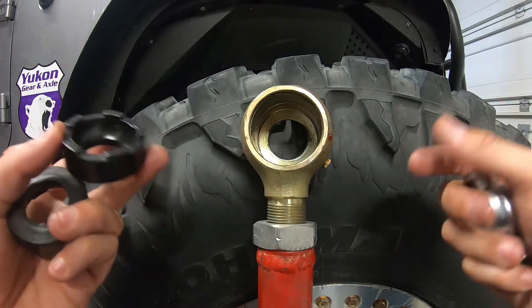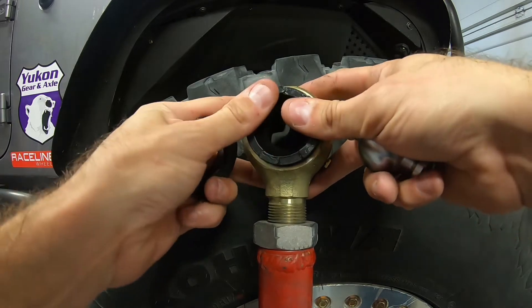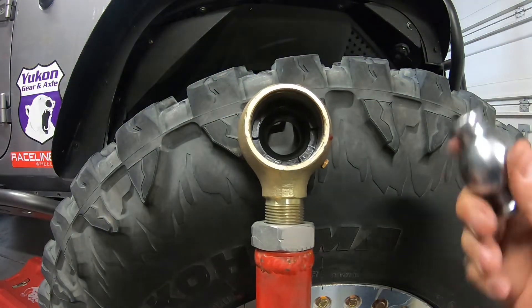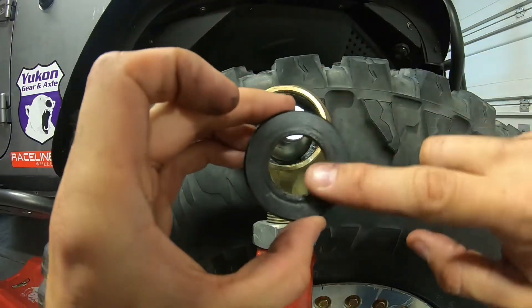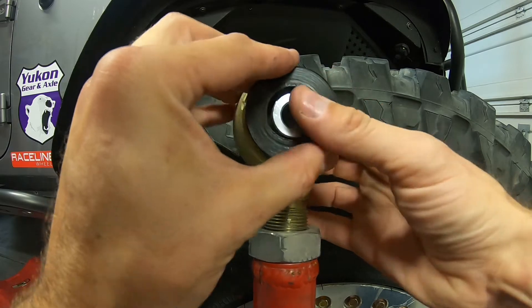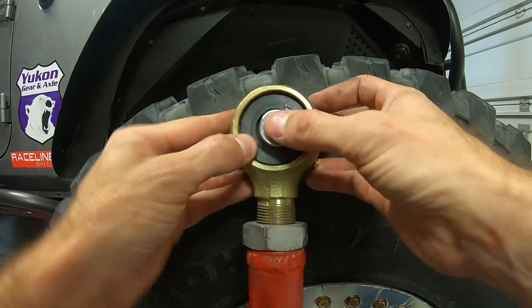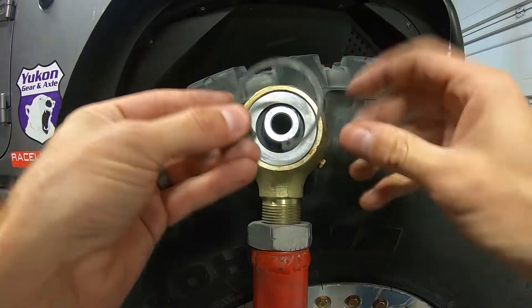To put this joint together and service or rebuild it, you take one rubber bushing, push it all the way in, then take the ball and put it in, then take the other rubber bushing and put it in facing the other way so the flat edge is facing out. That allows the ball to float around in there. In order to hold all that rubber in there, a washer comes in, sits in there, and then a C-clip goes in and clips it back in and locks it. Before I show you exactly how to rebuild this joint using that tool, I'm just going to talk about what I use and why.